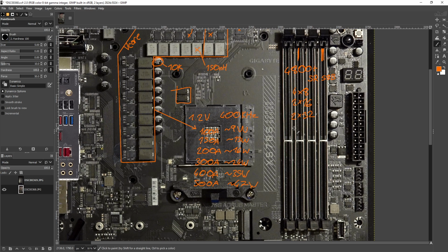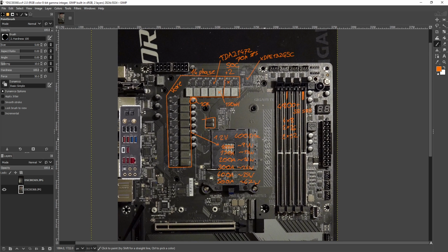But either way, this topology already is more than enough to completely max out the Infinity Fabric on any CPU with any memory configuration, except perhaps 4x16 Samsung B-die. Because 4x16 Samsung B-die is quad rank, and the memory controller doesn't like having a bunch of ranks attached to it. Especially not of Samsung B-die, because that stuff's heavy, which is why I pointed out the 2x32 configuration, because 4x16 in my experience is just a terrible idea.